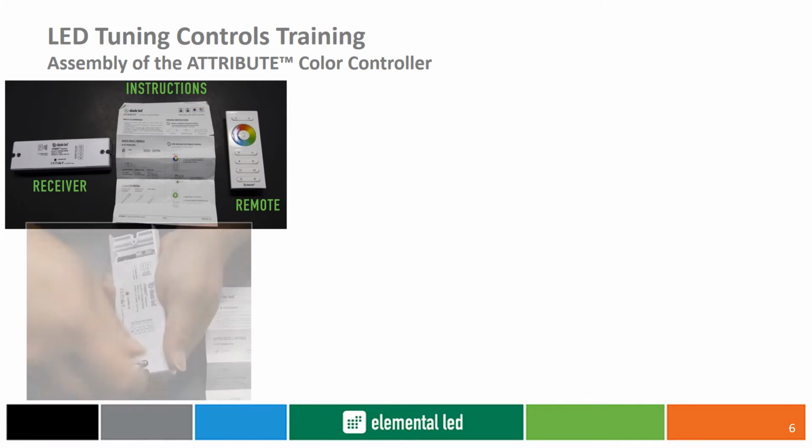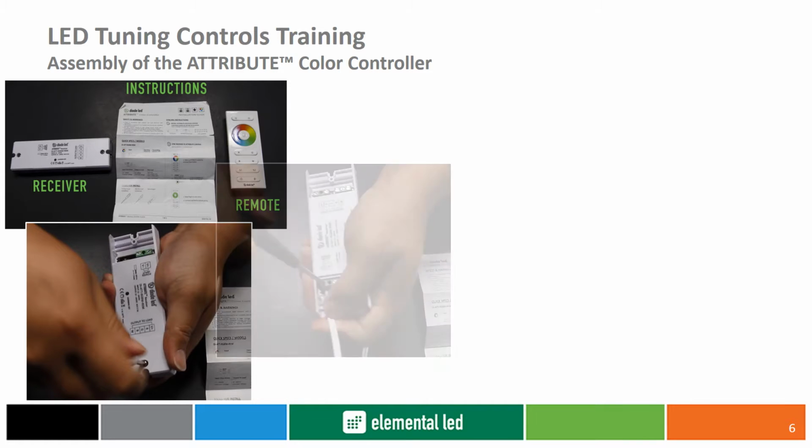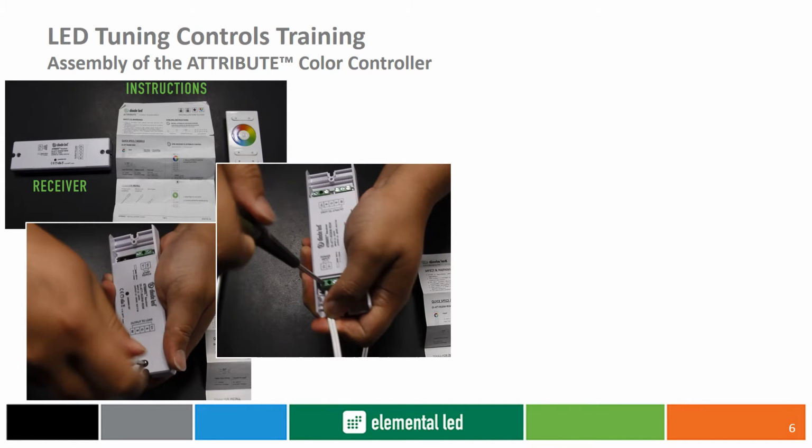Step 1. Taking the Phillips head screwdriver, unscrew and open both lids of the Attribute Color Controller receiver. This will expose the contact terminals to insert your color-coded wires for the LED lights and your low-voltage power input. Step 2. You will need the flathead screwdriver to make your appropriate wiring connections for the LED lights and low-voltage power. Refer to the label found on the Attribute receiver for the correct connection locations.